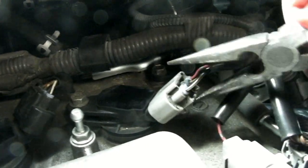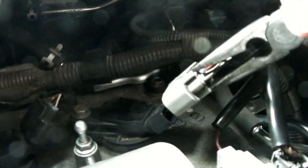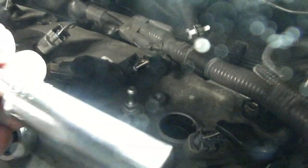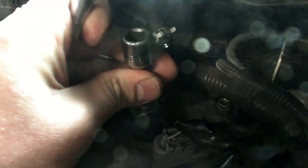Because you're going to want to take the wiring off your coil packs. The best way I found is to get some pliers, squeeze on that connector, and they pull right off. To get your coil pack out, you're going to need a 10mm socket and ratchet to loosen that bolt. To get your spark plug out, you're going to need a 14mm socket and some short extensions. You need the short extensions because you have to clear the coil here. What I'm doing is putting on one extension, getting it in the hole partially, and then adding the other extension onto it once it's in the hole.